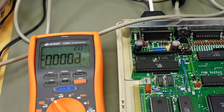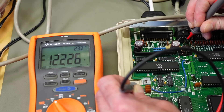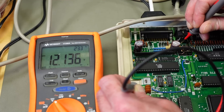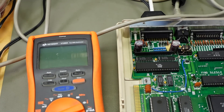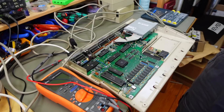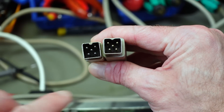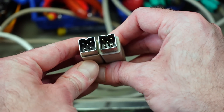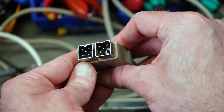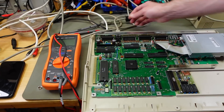Let's look at these with the other power supply. With the other power supply the Amiga boots up. That's our 5V rail — that's how it should look. That's the -12V, and that's our +12V. So the +12V is low and the +5V is super low with our problem power supply. The 5V rail is so low that it doesn't even make sense that any Amiga would power up with that. So we might have an issue with the connector here — maybe it's a bit wonky. The working supply's pins look a bit bigger and thicker.